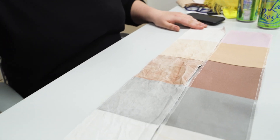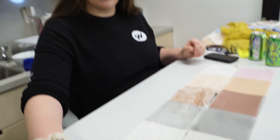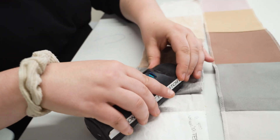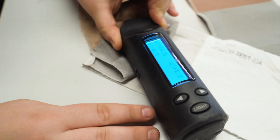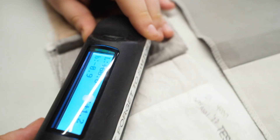As you can see, it's not completely clean, but these things aren't designed to be completely clean. They're designed to show you the differences between wash cycles. If all the stains came out, there'd be nothing to measure. We read the stains with this color reader — put it on, press the button, and you get some numbers. These numbers correlate to a specific color, and then we'll put it in an equation to calculate the stain removal index, which gives us a number we can use to compare the different stain swatches. But we also compare them visually — nothing beats the human eye.